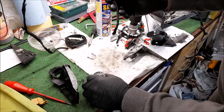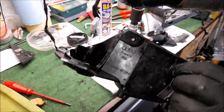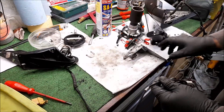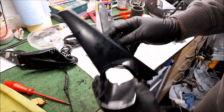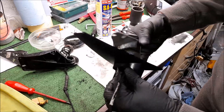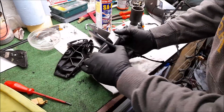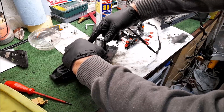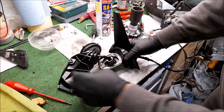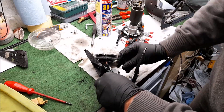So now: cup and spring — that is right. Then the headpiece which holds the mirror itself, put that down through there like so. Get your plug down in there. Pull that cable back through there, being careful not to snag it because it is old. Get the tie wrap in there so it can't be pulled. Put it back on there, pop that in there. Spring and shoe on there, now I've got to push that down and get the horseshoe back in.